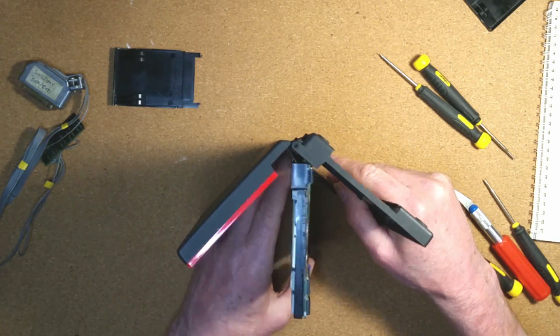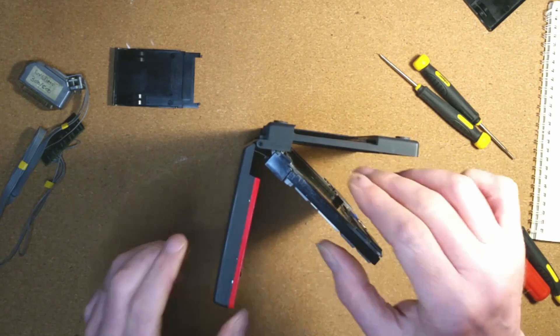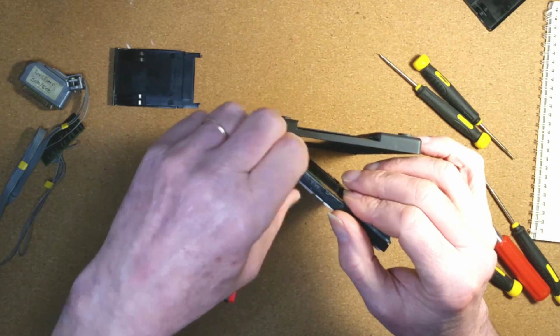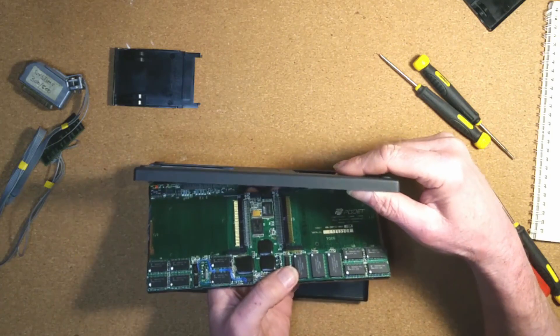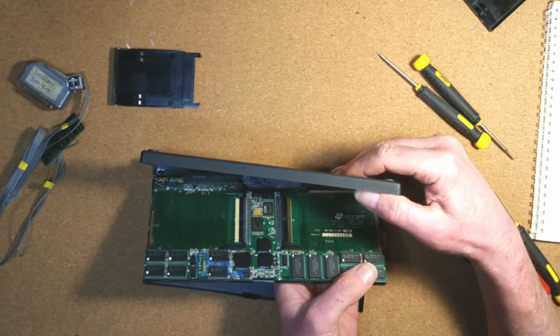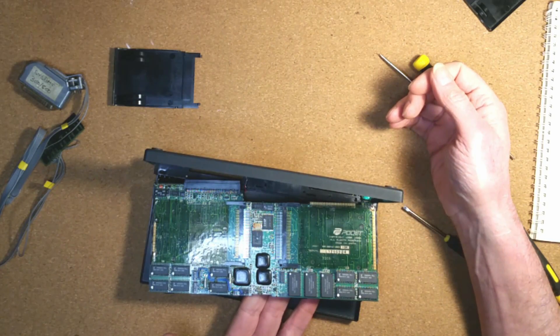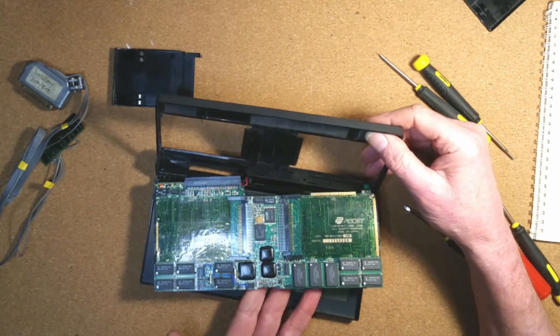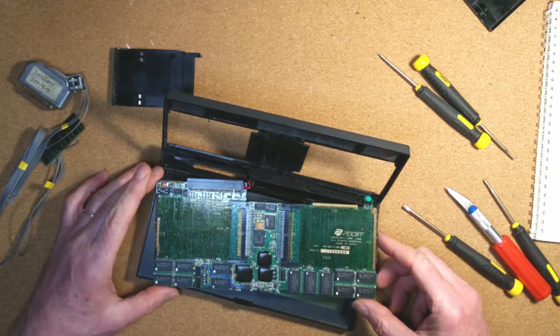With the welds broken, remove the plastic cover from the power supply at the rear of the keyboard, then gently twist and pull it from the case sufficiently so that you can turn it over and examine the motherboard. Pay particular attention to the coiled ribbon cable between the computer and its screen — this is delicate, and there is no way to open the screen to replace it that would not result in its destruction.